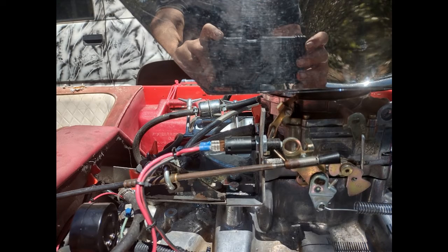I used a brake lamp switch. I made a special bracket and attached it to my intake, and the throttle hits the brake lamp switch when it's fully rested. I had to put a good return spring on there and I had to change the spring inside the brake lamp switch because it was too strong. So I stretched it out, cut it in half, put it back in there and made it weaker so that the throttle return would shut all the way.